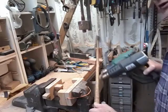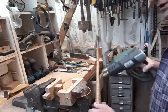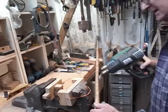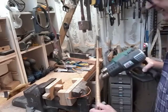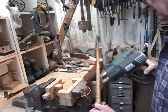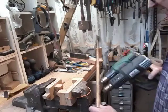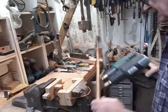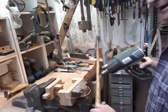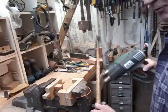The two hot air gun technique is very good on ram's horn. Ram's horn, especially the big horns I tend to get, does take a lot of heating. So if you can hold two guns in your hands at the same time it speeds things up a little bit. Again, keep your hot air guns moving — don't burn your material.